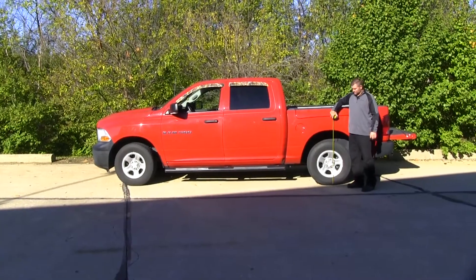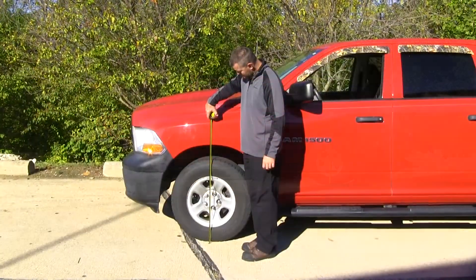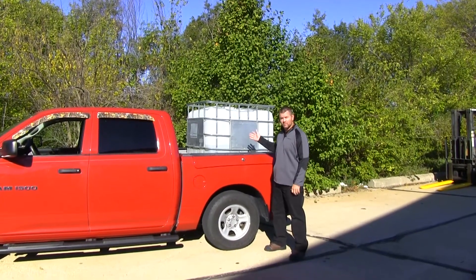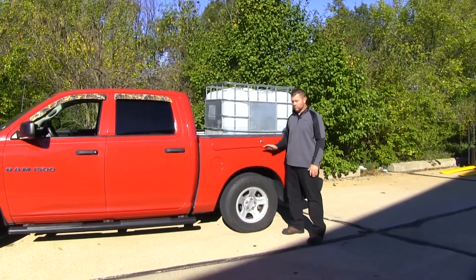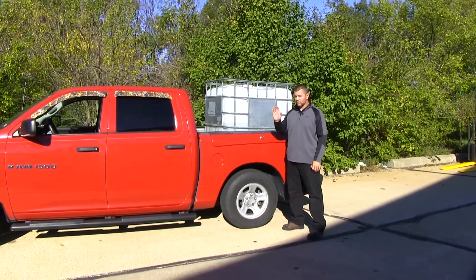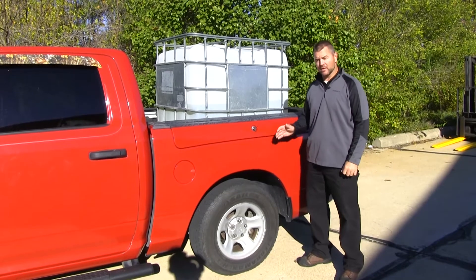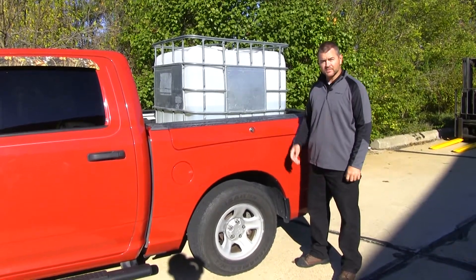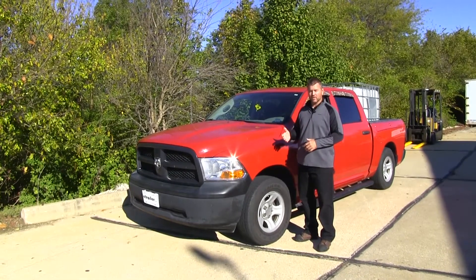To begin your installation, you're going to want to get measurements on the back and the front for normal ride heights. We've gone ahead and done that, and you can see we've added approximately a thousand pounds, and what it's done to the back end of the vehicle is it's dropped it three inches. It's also raised the front end about a quarter of an inch. That's going to add unnecessary wear and tear on the tires and pressure on the suspension. The front of the vehicle is going to affect your steering, handling, and overall braking.